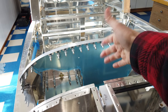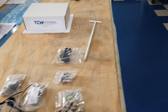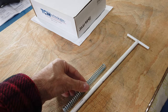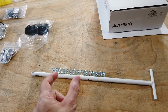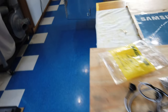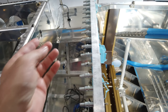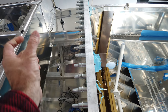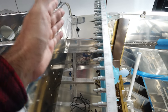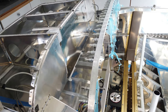So what I'm planning on doing is modifying the handle. I'm going to figure out where I can cut this handle and put in a splice somewhere in between the panels, so all I have to do is reach up underneath the instrument panel, pull out a pin, and then the handle will separate — this end stays attached and this end comes out — and then I'd be able to take the instrument panel off. I'll show you what I came up with once it's completed, but I won't do a step-by-step on splicing using a piece of tubing.